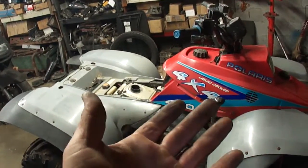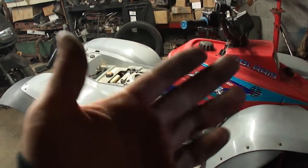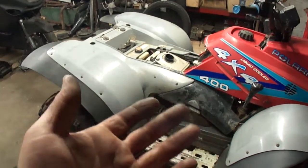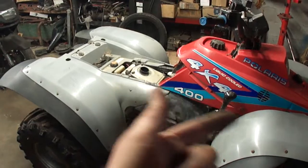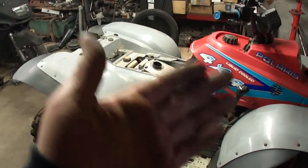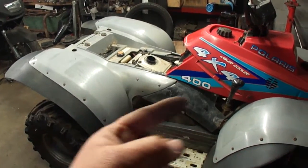If you have your RPM set too high, it'll grind when you try to shift it into gear. So you don't want that. That's bad. If it's idling too low, then it's going to want to stall and it'll be hard to get into gear. You might have to blip the throttle and hold the shifter at the same time. So you want to get it in that 700 to 900 RPM range. 1,000 is okay, but that's getting a bit high. That's hard on the transmission.